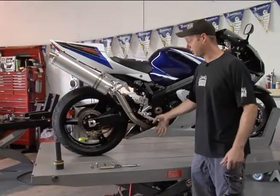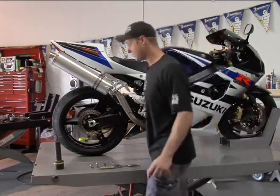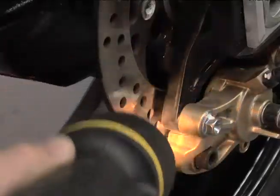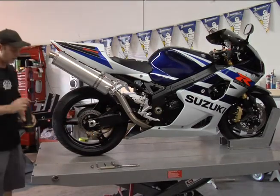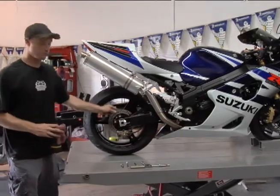You should always make sure your pedal is hard and not soft or spongy. You can also visually check your brakes. Usually with a flashlight, you can just look and see your pads and make sure your inner and outer pad are both good — they're not real thin. If they are, you'll get metal to metal, which is not good. It will ruin your rotors.